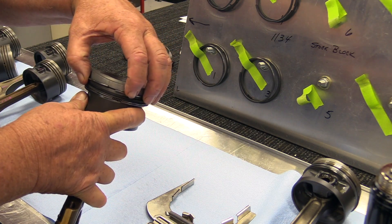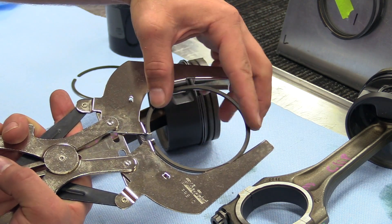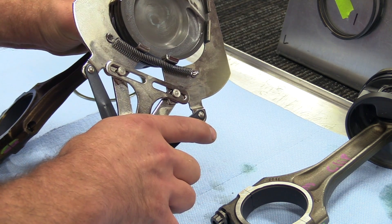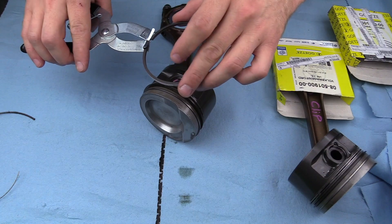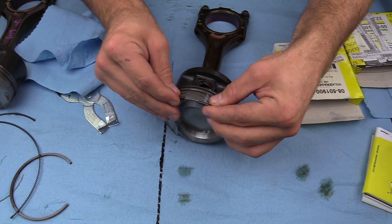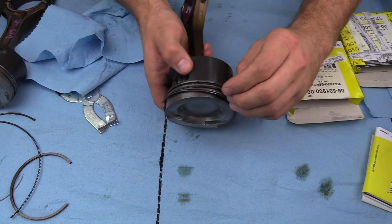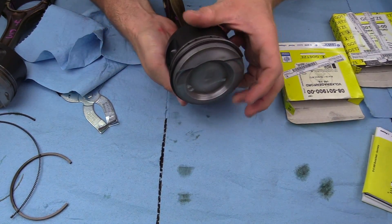Next, we're going to put the rings on the pistons. There are two main ways to do this. One, using piston ring pliers — these can work pretty good, but they do take a little bit of finesse. If you have old piston rings, I recommend test driving the ring pliers with the old ones to get a feel of how easy these rings can break. The other way is to roll the piston ring on — this is actually the way that most engine builders do it. It's quick, it's easy, and you actually have less risk of damaging the piston ring. Just make sure you do not over-twist the piston ring, because it can distort and you still have the opportunity to break them.